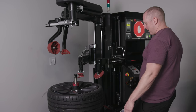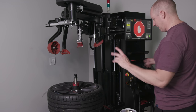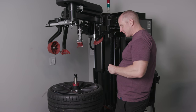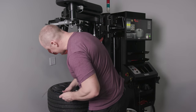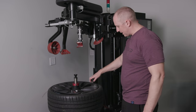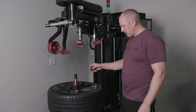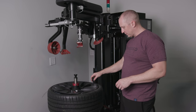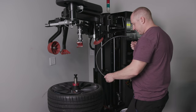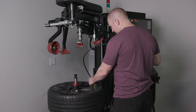This will now all come out of the way. Get to go. Whenever that red thing comes up, it just means that you can let go of the go button. I'm gonna put some air back in. I don't think I need to do a bead massage, at least not at this. This should pop. And that's where putting the lube in, I think, has helped. I haven't had any issues with the bead seating. So this thing just has an automatic torque spec where it clicks good. I like to, leaving it clamped, feel safer when it's popping or when it's seating the bead.